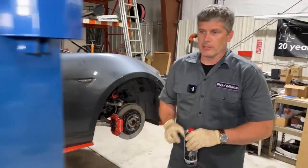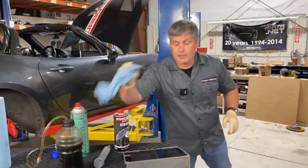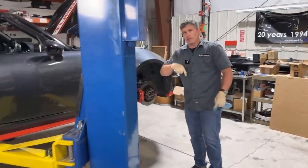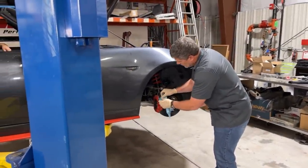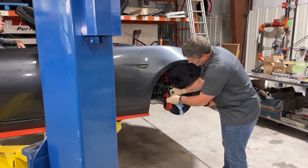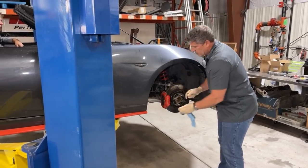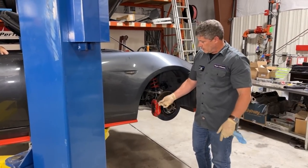There's another way I like to do it. One more option is to use a vacuum bleeder, like a Mighty Vac — a little vacuum pump — where you basically suck the fluid out from the caliper end. That works; I find it a little bit messy and you've got to have the tool on hand. My favorite way of doing this is a little bit slower but works well, especially on vehicles with really convoluted brake lines like old Land Rovers. It's called a gravity bleed.